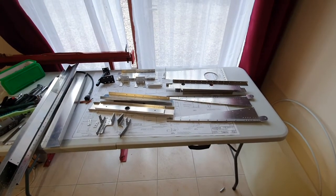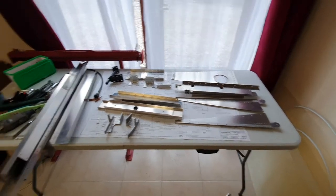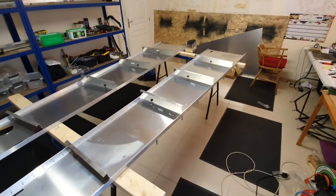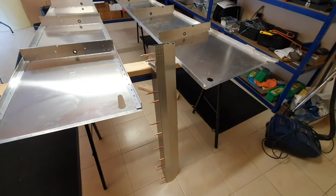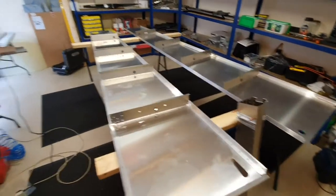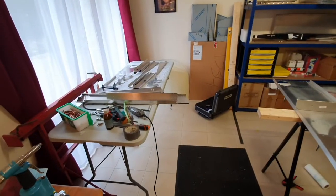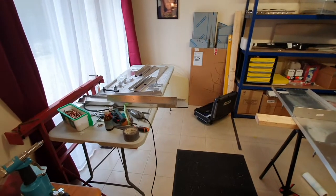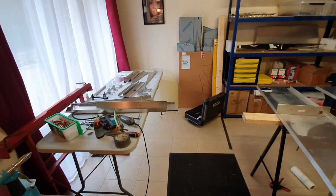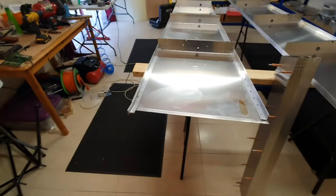Four and a half hours of deburring later and the entire thing is stripped down to its constituent parts - everything's been deburred that can be deburred. The two sides are all deburred, and the crosstie box is standing there again - up-drilled and deburred as far as it can go. The next task is to reassemble it and look at what's next. I think the flap actuator is probably going to be my next thing, because I need to do that before fixing anything at the front end of the tail cone.